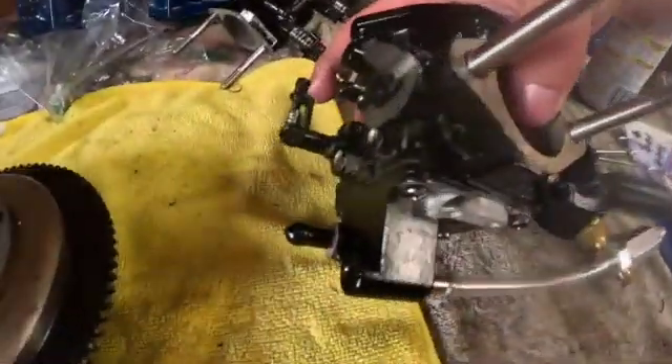There's a little video on setting crack pressure. Make sure your rubber seals on the back of these carbs down here are good — you might even want to use a hose clamp. It's very important; you want to make sure you're not leaking. Pump that gauge up, let it sit, check for leaks, check for bubbles. So there you guys have it — quick little video on doing crack pressure, pop off pressure on the BN38s. Thanks for watching. I'll see you next time.